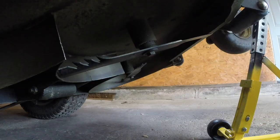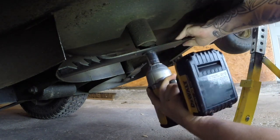Going back to the Magic Mulchers — I run those because they help chop the leaves up quite a bit more so I'm able to fit more in my can, because the pieces are smaller. With that being said, I want to grab my impact, take one of these blades off, and show you how the mulchers go on. We'll pull one of these blades off — I'll pick the center one here.